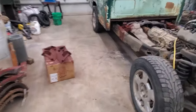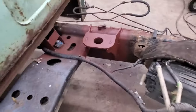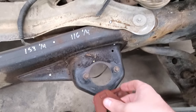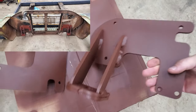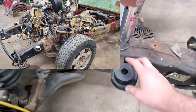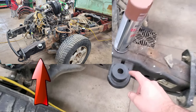Welded up all the cab mounts on the frame, painted them — don't look half too bad, shouldn't be going anywhere. And then here are the mounts that go up to here. Used the factory cab mounts, so they bolt onto there. And then these go on to the front radiator support member. So I had to add another plate there to raise the cab up. In the front, these are the radiator support mounts — those doohickeys right there — they'll go onto the factory expedition mount here.